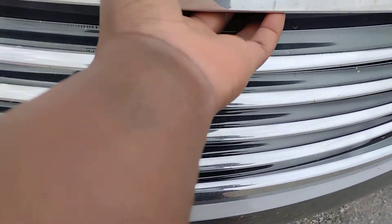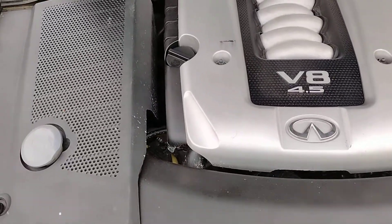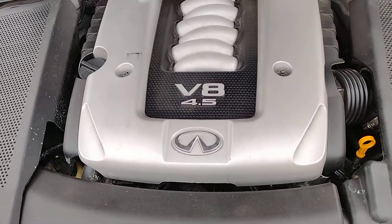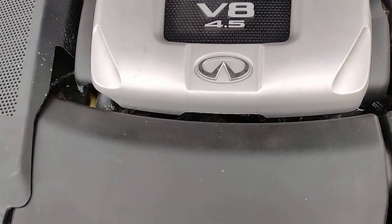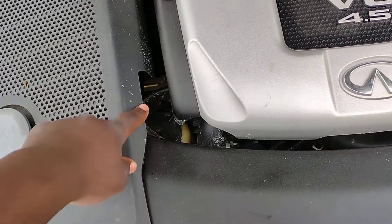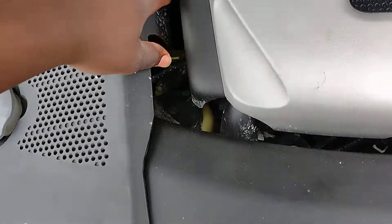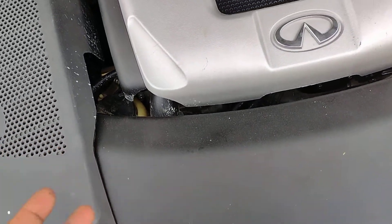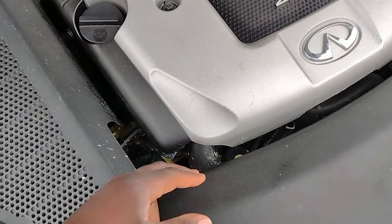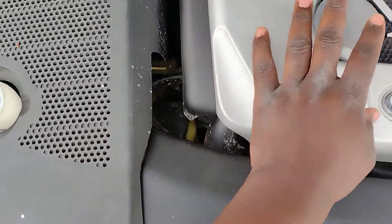This is my brother's M45 and I asked him to pop the hood because it smelled a little peculiar. Now I look at this and I know the reason because I see spots like this. This spotting right here is usually a sign of a coolant leak. Coolant is green or blue, but whenever it's hot and touches anything else it dries white.